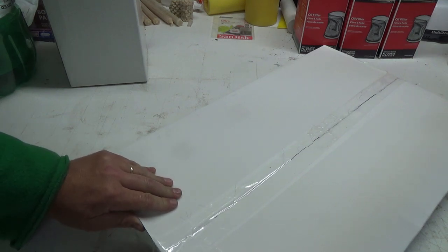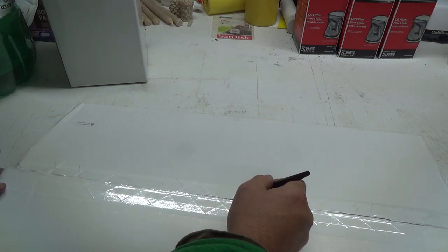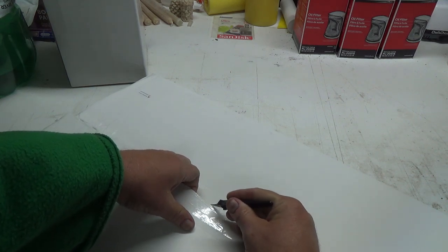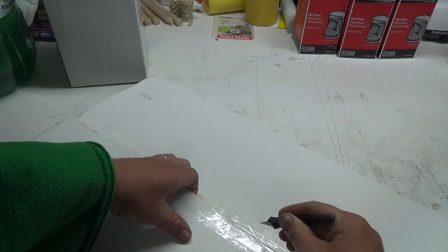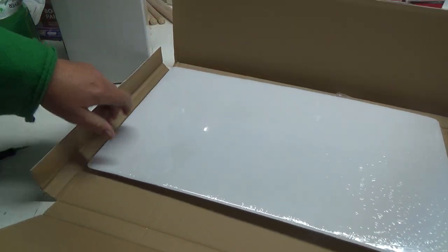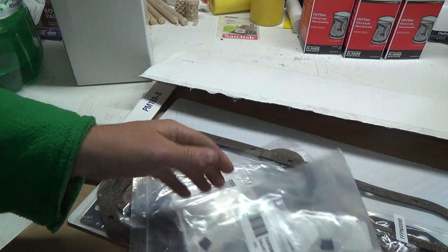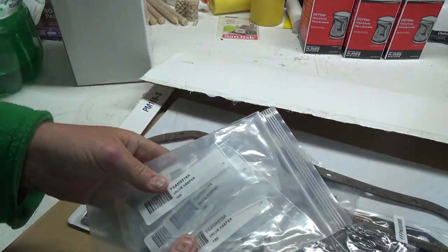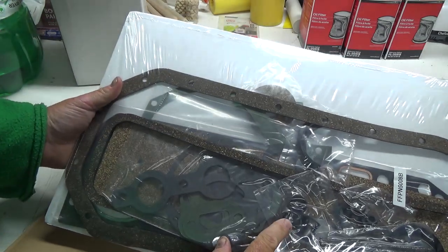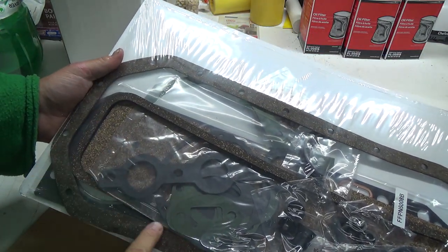And this is the gasket kit here — I wanted to have a look at that too. So we'll have to re-gasket everything again, of course. The only reason I wanted to do this — I should have done it when I had this stupid thing apart. I thought it was valve guides, but apparently not, it's still burning oil like crazy. So we'll tear it apart and do a cylinder sleeve and piston ring rebuild — do the whole thing. Same rods, we use the same rods, everything else should be good, but it's all been changed anyways. There's some valve keepers too, for the valves, that we're not going to need. So that's good — we don't need them. So there are the gaskets — there's a complete gasket here, you have the mains and everything: head gasket, oil pan gasket, rocker cover gasket — take all that off again.